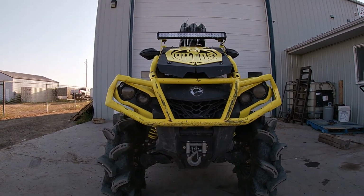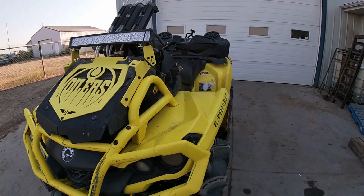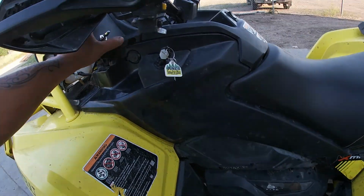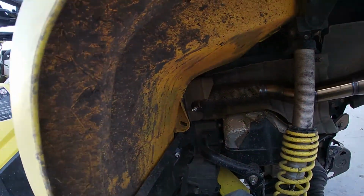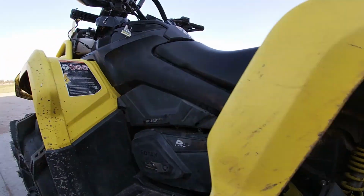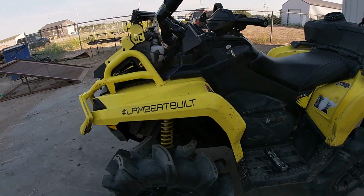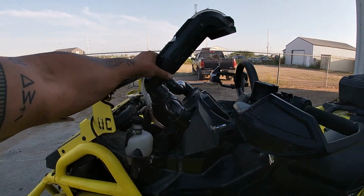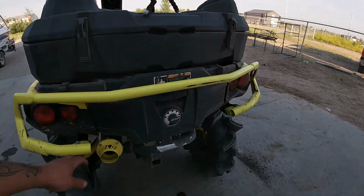So here's the finished product. So I went through this bad boy, did thermostat delete, fan override, on fused ignition power, boom. Exhaust header wrap, the whole exhaust, and titanium header wrap, as you've seen in the videos. Put the slip-on on, got it running cool, got it kind of running right. I went ahead and also sealed up the snorkels in multiple spots. They were definitely leaking from a lot of different areas.